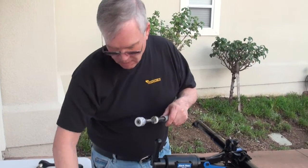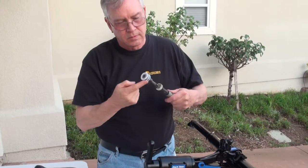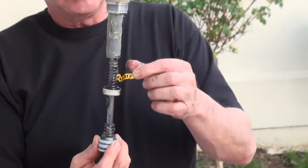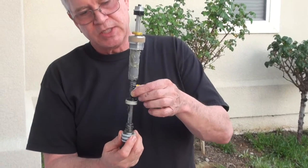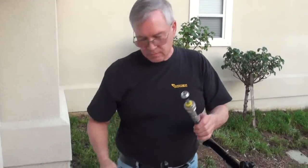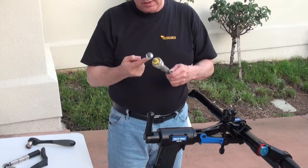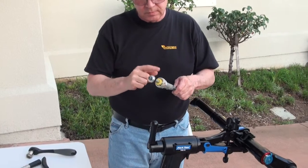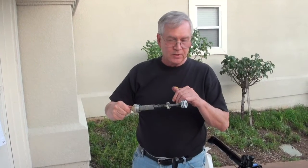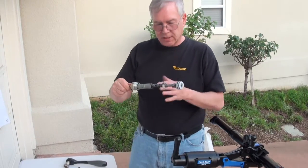Make sure that you fill the gap. If you needed to grease the rest of the air spring, this one's good enough, but you'd pack grease in here mostly just to keep the spring quiet when you're riding the bike. Next, come up here and use your regular grease to make sure that you grease all the bushings. That's all there is to servicing the air spring — use a high quality grease on the lower piston, and we use Slick Honey every place else on here.